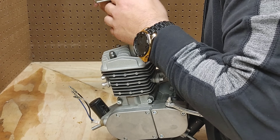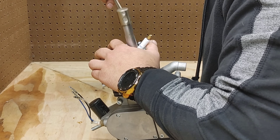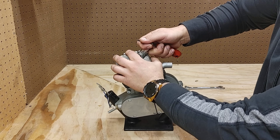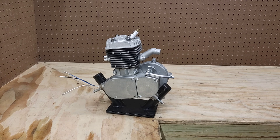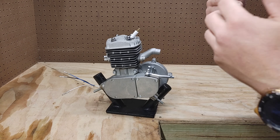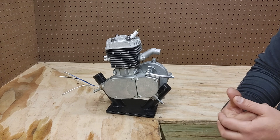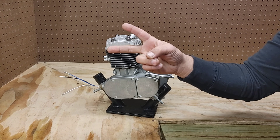I don't usually go by foot pounds exactly, but actually it is around five foot pounds — about five foot pounds is all you need. The last step: get the spark plug down with the spark plug tool that came with it, get that nice in place, and we are good to go. Great job guys — you did it! You assembled your motorized bicycle engine. All you have left to do is get this on a bike and get it on the road. Make sure you hit that subscribe button and thumbs up — this thing is going on an awesome bike next. See you guys on the next one!